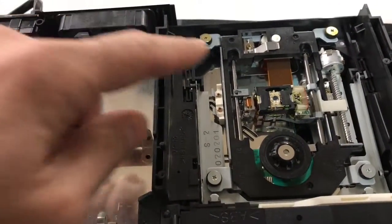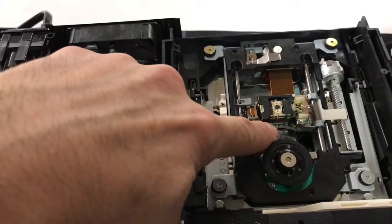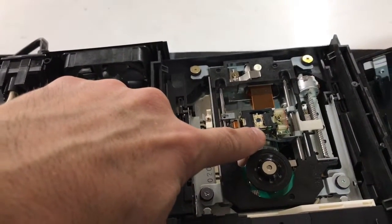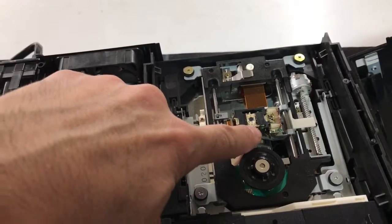On this system, all I keep getting on my screen is 'reading disk' and it just keeps reading — I'm not getting anywhere. There are two screws on the bottom here that are gonna intensify your laser and you turn them clockwise. We're gonna get there in a second.